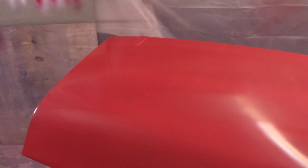Again, I'm running into the discoloration there, if you can see that. Again, hopefully this 3rd coat will cover that. I also didn't have real great overlap on this boot lid, but I'll try to get better next time. A lot of trash again, and I just think that's how it's going to be. So obviously I can buff a lot of that out, the way that the doors came out. So anyway, that's going to get the third coat on here, and that'll be it for tonight.